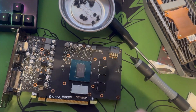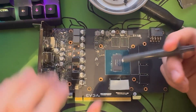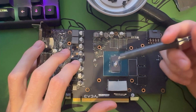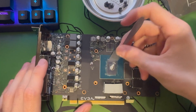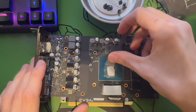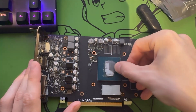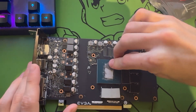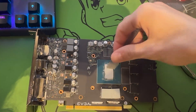It is recommended to replace your thermal pads — I'm going to because mine were dusty as hell. Just be aware that they're awkwardly thick and kind of hard to find. My process for putting the paste on the die is I put a little dime-sized amount and spread it with a spatula from the side. The main thing is to get the paste spread over every corner of the die. If it goes off the side it doesn't matter — you could also just put it on in a dime and squish the card together. I just like to make sure every corner of the die is covered.